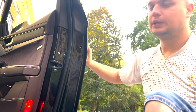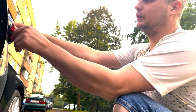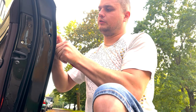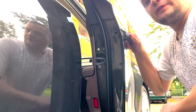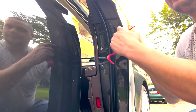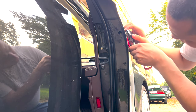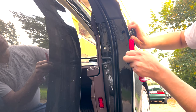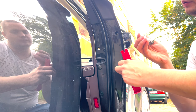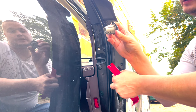And then take the plastic trim removal tool again, and put the plastic trim removal tool between this. I'll try to remove it, and I fiddled with this part to get the door handle out, but the trick is here that you unscrew the T20 Torx and push it in a little bit, and when you push it in, then the part comes out. For the right side there is no screw hole, keyhole, and there is nothing behind this.